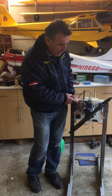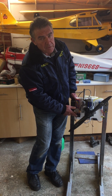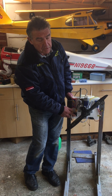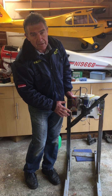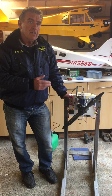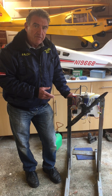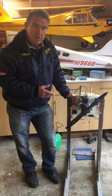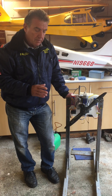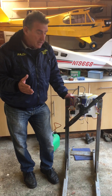For those not familiar with the Autostart system, it consists of an electric motor driven by an independent battery source and a gear train. It's switched with a relay which has a control wire, rather like a servo, that goes into the receiver. You've got total hands-free starting from the transmitter — once regarded as a gimmick, a lot of people have now realized this is a very safe and practical way of starting the engine.